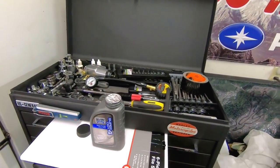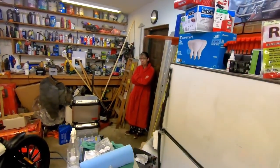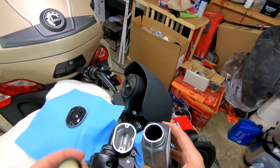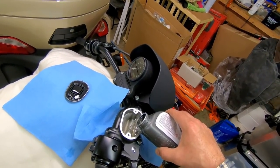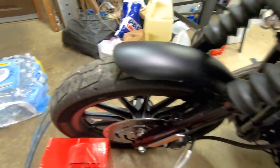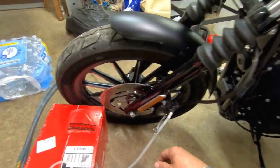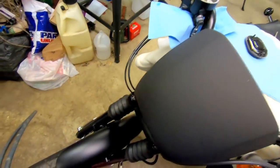Out of a clean container — let me open this up and we'll go over to the bike. Nice clean, open container. Little mama came out here to say hey — she probably didn't know the camera was on. Look at that, look how pretty that is. So the first bite: taking it loose, you need to get a good hold of everything. Harley didn't over-tighten it, which is nice. Grab your little bleed barrel, give her a squeeze, let her start flushing, and watch your reservoir.